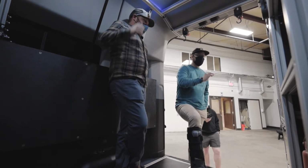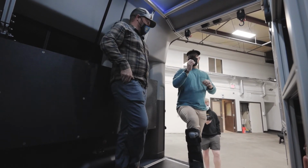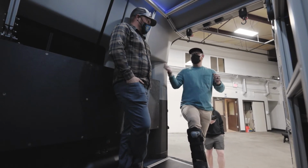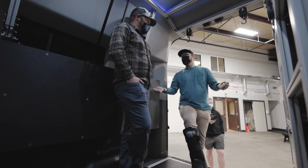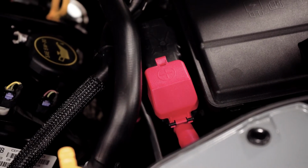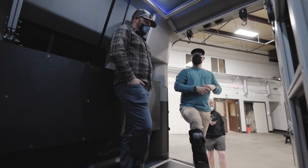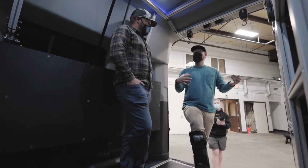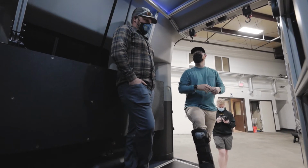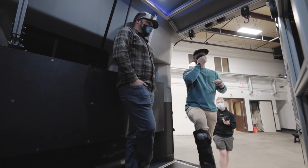So the Transit batteries themselves are underneath the driver's seat, but they have a positive terminal that runs to the engine bay, and you can still jump start the vehicle from inside the engine bay. Okay, cool. That post in the engine bay is what we piggyback off of to run to this ACR. Gotcha. Some people have not read their manual, and we've seen posts where people removed the driver's seat to get to their batteries to jump start it, when it's fully accessible under the hood. You don't need to get to that yourself.